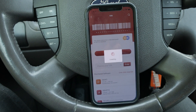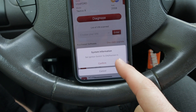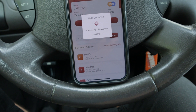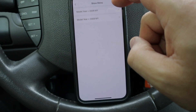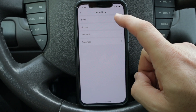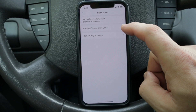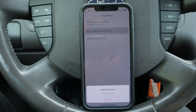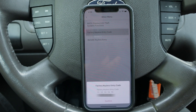We did previously download all of our car modules. We can see we had a pop-up: set ignition switch to on position. On position isn't running, and we're already set where we need to be. Make sure that you're following all the on-screen instructions because it will really help you be successful in scanning for issues. Go ahead and select our year — the security functions are under special features, part of the body — and we'll go to security. This is going to be the factory keyless entry code. Turn on ignition, but we don't need the car started for that. Hit the confirm button, and here you can see it popped up the factory keyless entry code.